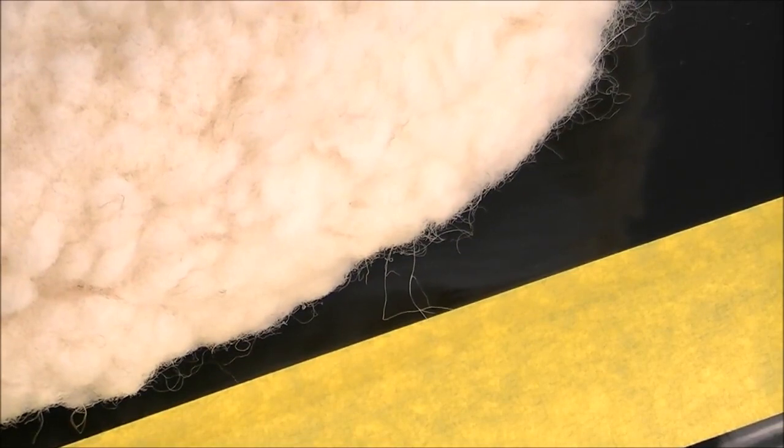Okay, so we can take care of that haze. First thing I got here is the rubbing compound. I'm going to use a wool pad. I've taped that edge off there just to kind of protect that edge so I don't burn through with the polisher. And try and set it around somewhere between 1500 and 2000 RPM.